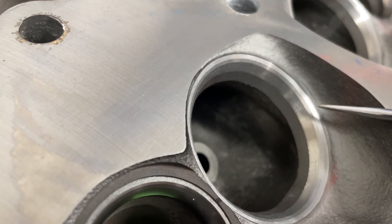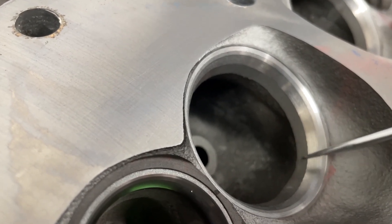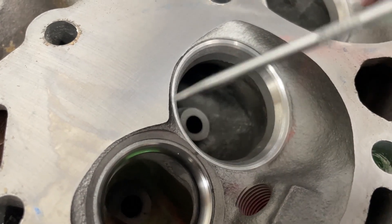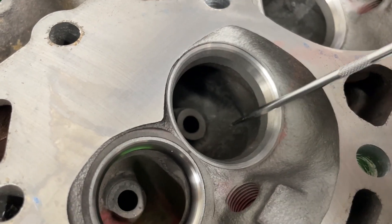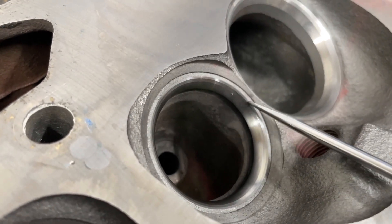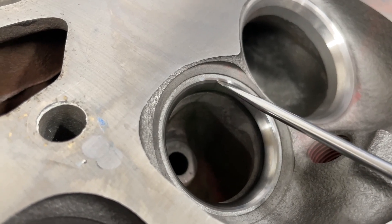The reason for using it is because I don't port them. If I'd used my other cutters I use for my other heads, it would have left a huge step right here, because when it cuts it's going to remove all that lip and leave a notch in there, and you kind of got to port with it. Now on the exhaust, this is a radius valve job — so it's 45s right through here, which you can see. But this is the radius cut.